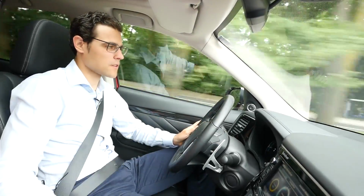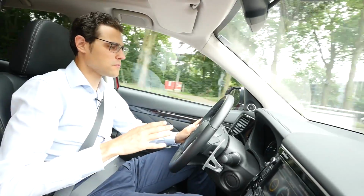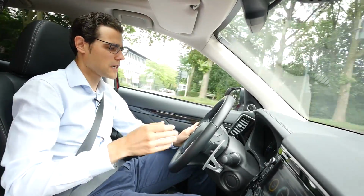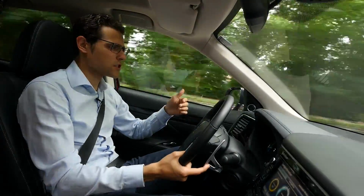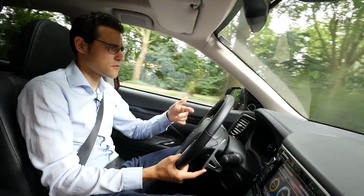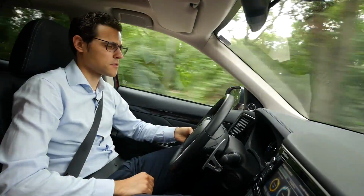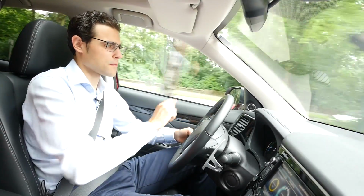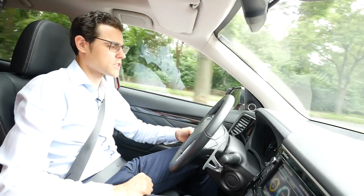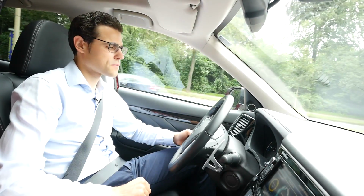Here, for example, going down longer now, I go to this recuperation mode, and I don't have to be standing on the brakes all the time. So you see, maybe it's too much recuperation, then I can lift it a little bit to B2. So you can also adjust it pretty much. No, but now there's more needed. Then I go to B5 again, have the maximum recuperation charge. And now hitting the brakes even more, and it's a little bit more charge.